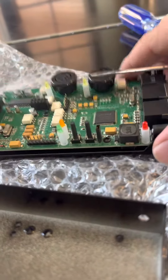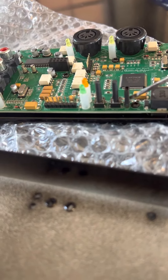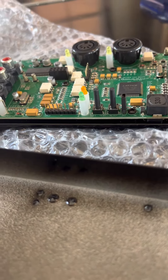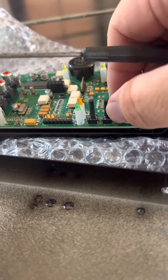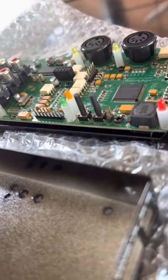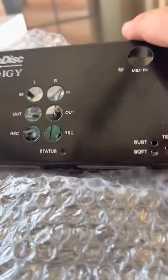All you have to do is look for a jumper, which is right there next to those two buttons. See that jumper? Just pull it off. By pulling it off, you're left with two pins exposed. Now when this thing boots back up, it will boot up as HD instead of Silent Drive Plus.